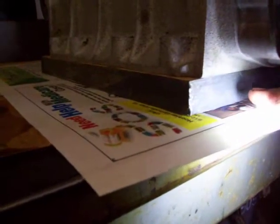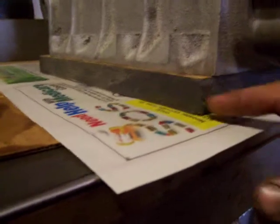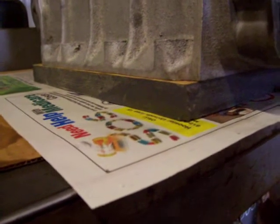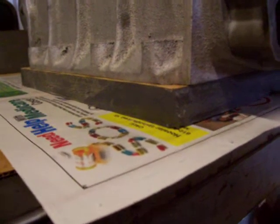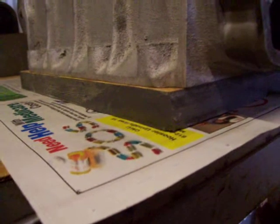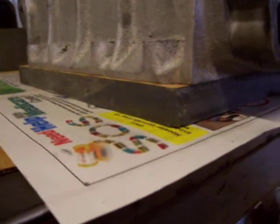Something's pretty amazing about that form plywood. I wouldn't have believed it till we did it on the Galaxy. You'd think that wood would be inconsistent, I could see it being out 25 or 30 thousandths. That piece of ply form is within 5 thousandths of an inch. We've checked it everywhere, and that's close for a piece of plywood with 11 layers in it. I couldn't believe that.